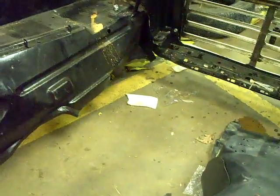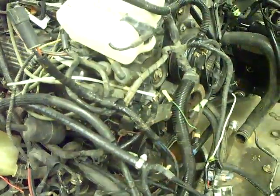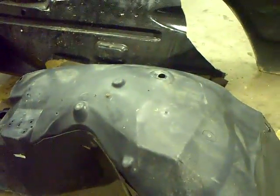This thing was not designed to have a V-8 with overhead cam heads on it and electronic engine management stuff, ABS, and all the other goodies — there's just no room for a lot of that stuff. So we're going to cut this out. As you can see, the old F-100 fender wells are straight and just come straight down. These Crown Vic fender wells are rounded over, so that should make more room in areas, and they're designed to have these components bolted to them anyway.